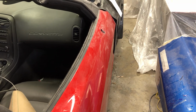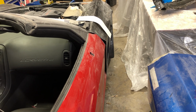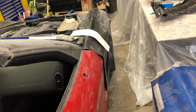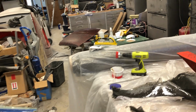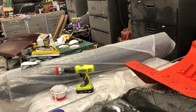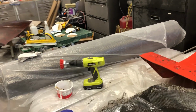It is more expensive, but it's really not a whole lot more expensive because you can use much fewer layers of carbon fiber to get the same stiffness, and the weight goes down significantly. That front fender that I did is 2.2 pounds. The back hatch was, golly, I can't remember. I think 7.8 pounds or something like that.